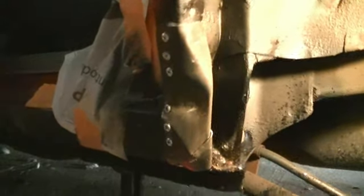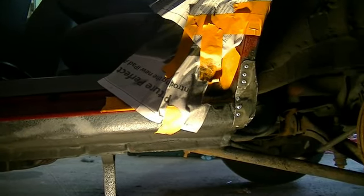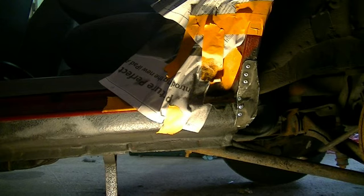Okay, we're just about done forming the metal. This part got dented in when I tried to squeeze it in there but that's the best I can do. I put a cut here and now I'm just folding it over a little bit — at least it will be strong right here. That's pretty good I guess. I'm going to rivet this together and put another couple of rivets here and that will be good. Then I can paint it. I think the last thing I'm going to do here is put a little body filler in here just to seal up the edges.